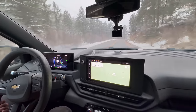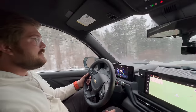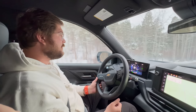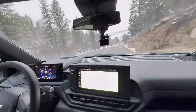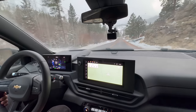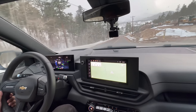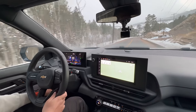Yeah, this is impressive. This is what we wanted. Even at 80% state of charge, it's got enough battery to take in serious regen, which is extremely important here. Look at that, 157 kilowatts of regen still it's able to do. I do have one pedal driving in high, so I'm just holding it there more or less, but no sign of degradation.